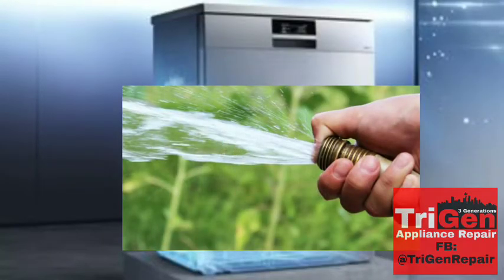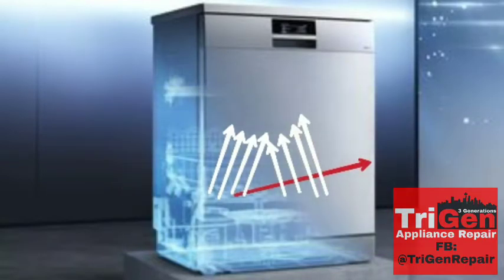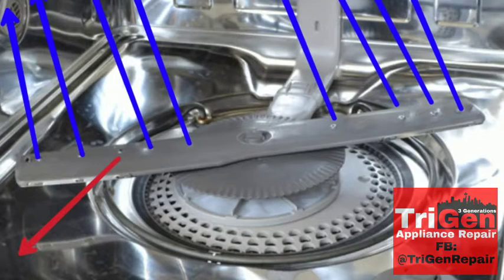We've all held our thumb over the garden hose to create more pressure or to spray the water somewhere we wish for it to go. Well, that's kind of what's happening inside the dishwasher, only it's food or debris kind of plugging up or halfway plugging up one of the holes in the spray arm or spray wand — either in the bottom, top, or middle — and it's redirecting it right into the corner of the door. The door seals or gaskets are not really made to withstand that kind of direct spray because it's quite a lot of pressure. The pump can really spray water pretty tough, and that's why your dishes get so clean.